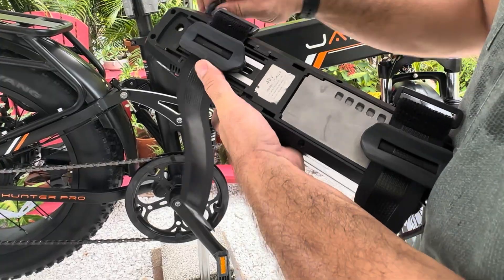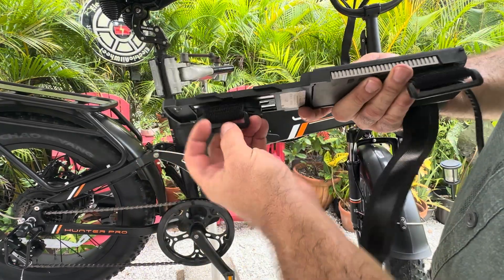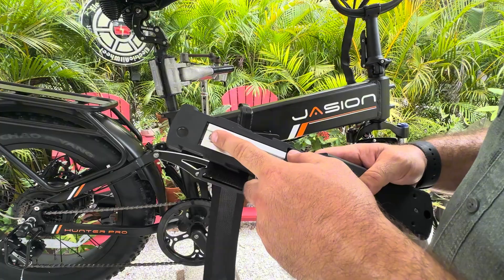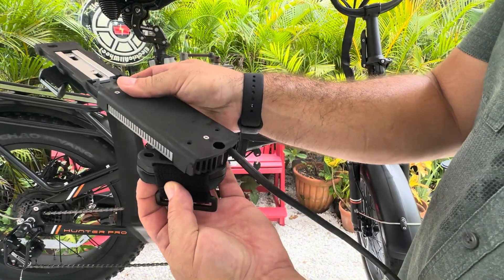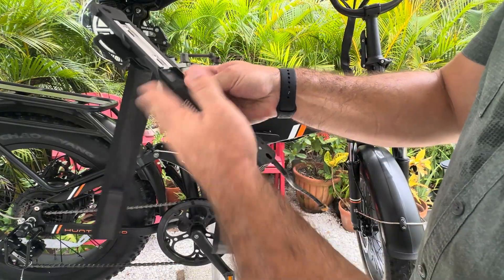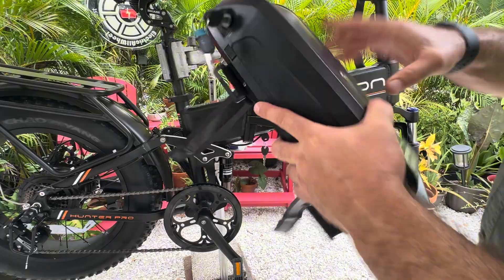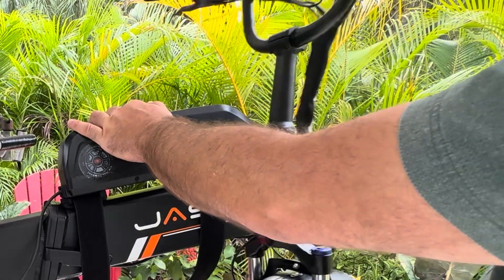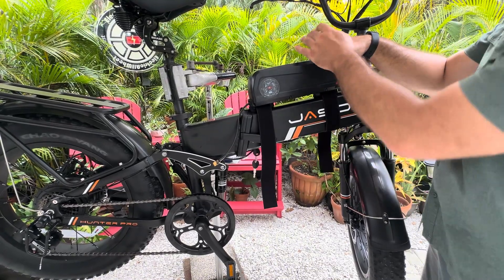So 25 to 26 amps off the controller — you need a BMS that can handle 26 or more, so 30 or 40 amp is a good look for these down tube batteries. It has the bike case strap adapters on it and we've already pre-installed these. You need to replace the screws that come with the strap adapters so that the battery can slide over the plate when the screws are installed — these are M5s, so we will leave a link in the description below. I like to make sure the straps are on the same side and then once installed I generally just lock it into the battery so it becomes one piece.